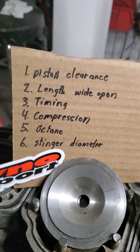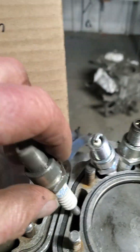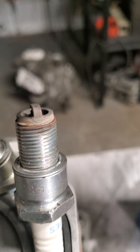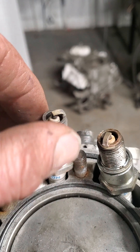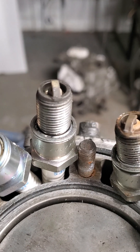The other misconception is everybody tends to look at the white porcelain on a new spark plug. You can easily read a new spark plug even in a five-second drag race run because of the heat on the prong. Here's a plug set up for 500 feet — see the heat all the way around it. Now if we take a look at this plug here, the white looks hotter to the inexperienced, but if you look back where the heat is, this plug is much colder.